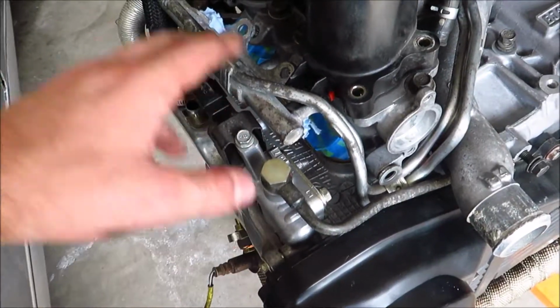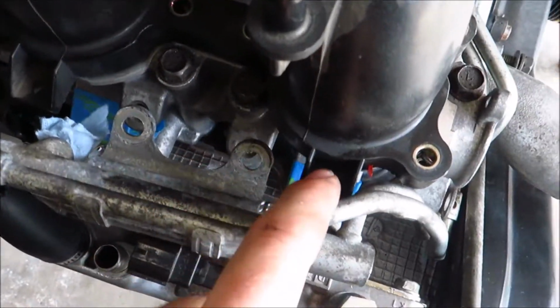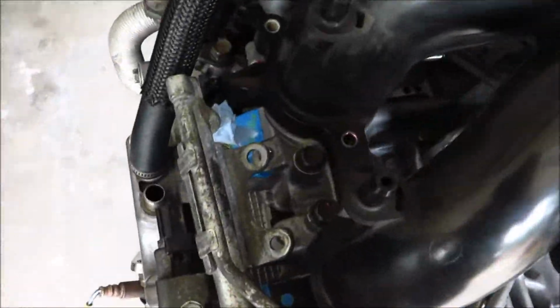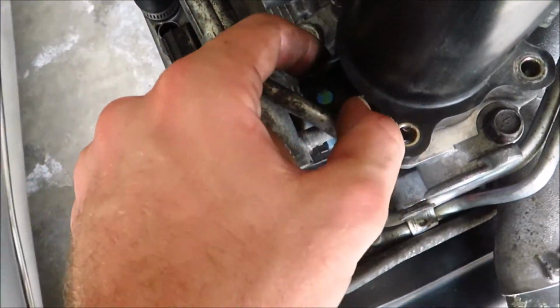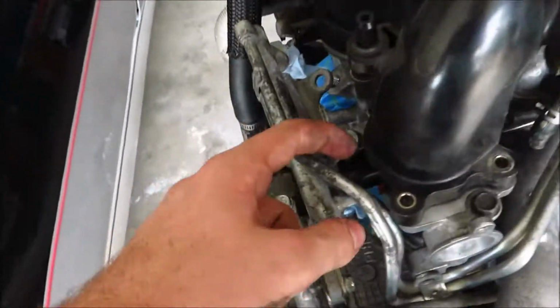While installing the intake manifold, I found another clearance issue, being this tab right here. Now I took a look at the other intake manifold and this tab is off, like there's no tab right there, but this one has it on all corners except that one. But I think I'm just gonna knock that one off of this one, just hacksaw it or Dremel it off. I gotta use the Dremel for other things anyway, so I might as well do it now.